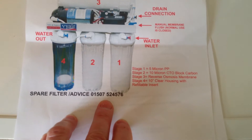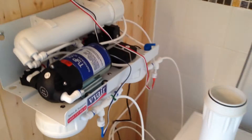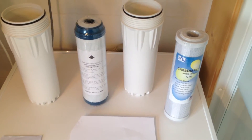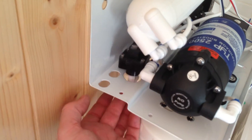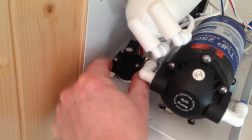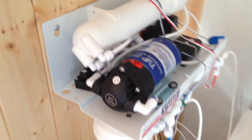I thought the smart thing to do was just to ring the guys — there is a helpline number on there and they've been pretty helpful and quick to answer. It turns out that currently these units are being built from a different type of unit as they go along, and somebody packed the wrong filter. They very kindly said they will post out two new filters to arrive tomorrow. I also mentioned about the pressure switch here being loose and how I'd recommend cable-tying it down — apparently it is supposed to be cable-tied, but I think I got a Friday afternoon rush job.